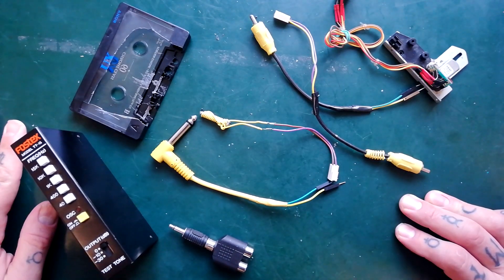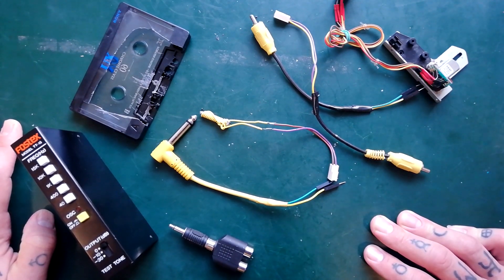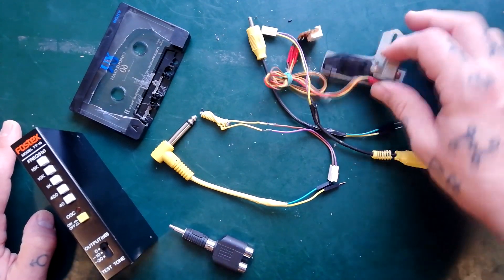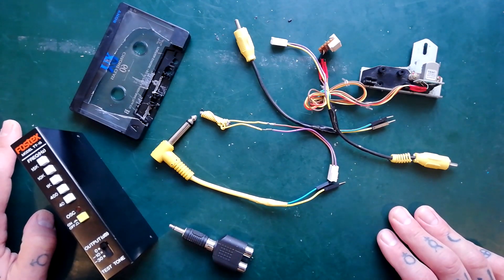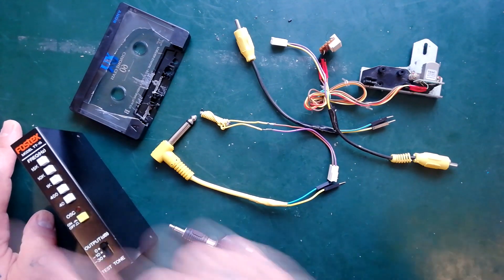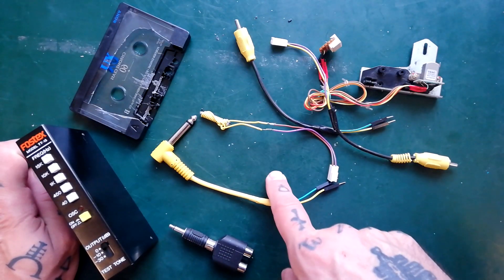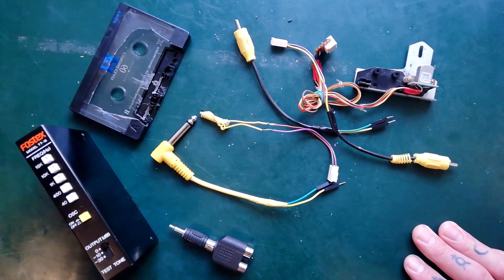A couple of times recently I've found myself with either a dead playback, or not getting recording on a channel, or one channel out of four isn't erasing properly. The conundrum is: which link in the chain is broken? Is it because the magnetic head isn't touching the cassette properly — a mechanical problem, maybe something up with the pinch roller or obstructing the tape path? Is the head itself broken? Is it the cable connecting the head to the circuit board? Or is it some component — a leaky capacitor, a dry joint, a faulty operational amplifier in the audio path? The continuity tester gives you a relatively simple yes/no: is that little electromagnet inside still intact?